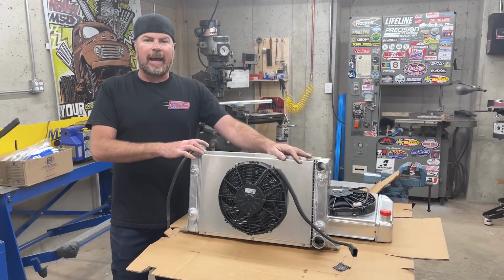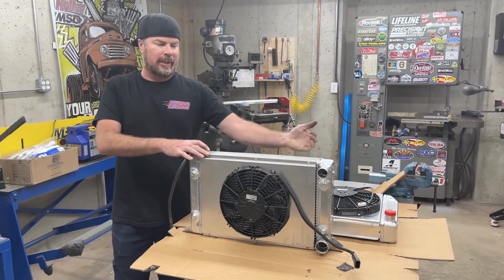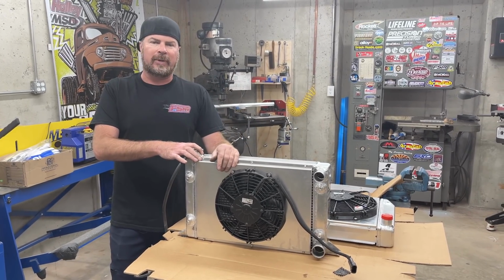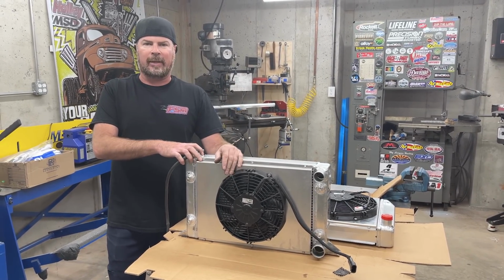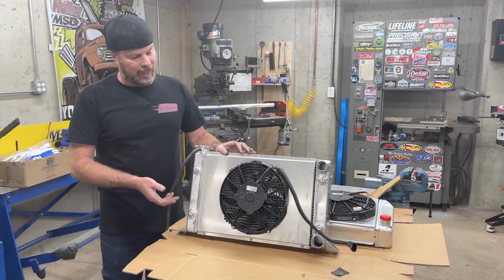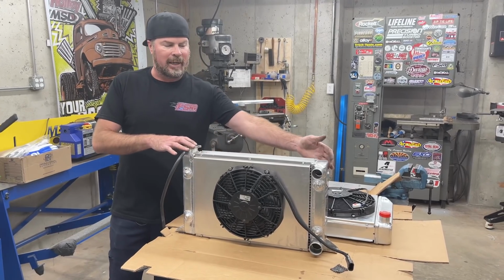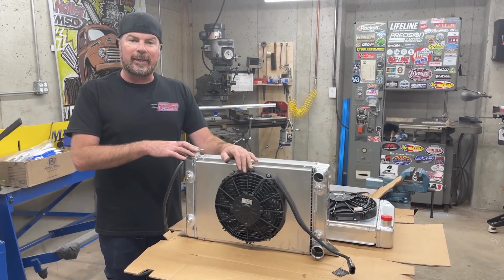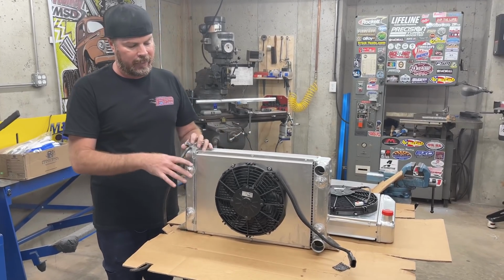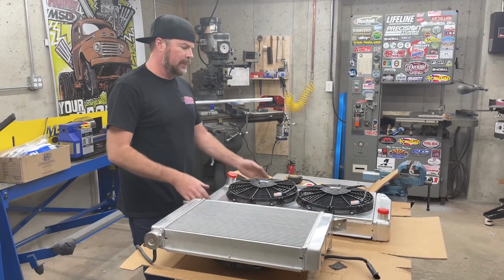This is the radiator that came out of the car. This is, let's be clear, for drag racing. This is modeled after a Volkswagen Scirocco, which is real popular for old school drag racers. They would say, give me the Scirocco radiator if they called up Jerry Bickle or somebody like that, who sold race car parts. And this is what you would get. It's about 15 inches tall. It is about 26 inches wide. It does not cool a 2JZ, even just cruising down the road for more than about 5 minutes. It's no bueno. It has a single 11-inch fan. Not enough. It's great if you're drag racing.